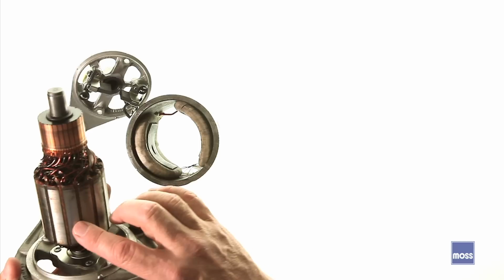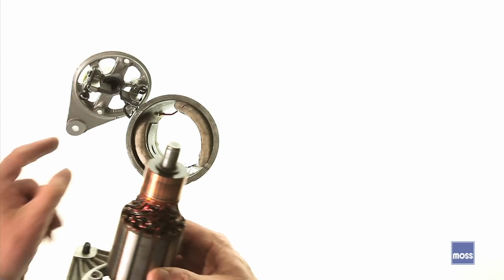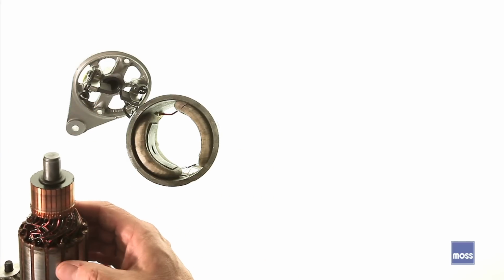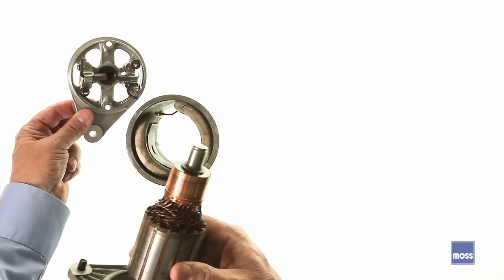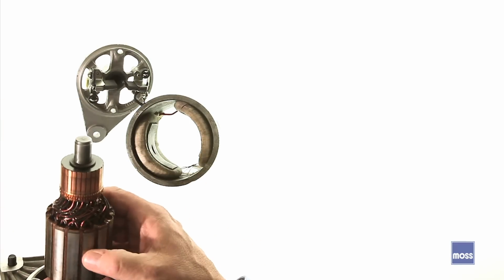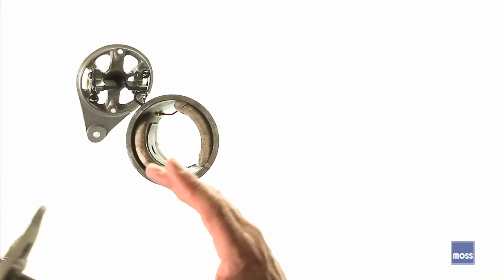Also, inside here, we're going to produce 15, 20, 25 amps, or perhaps more current coming through here, and that's all going to go through these brushes. What this creates is a real difficult situation for the brushes, and it means that they have to have routine maintenance. The brushes, and anybody who's had these cars for a while, have to be replaced from time to time. This part here where these bars are has to be cleaned from time to time, otherwise it simply won't be able to work. So with that going against it, the low RPMs and the maintenance, we needed something better.